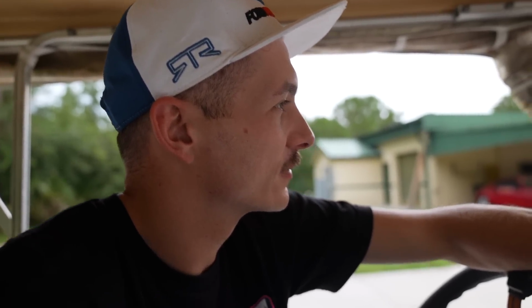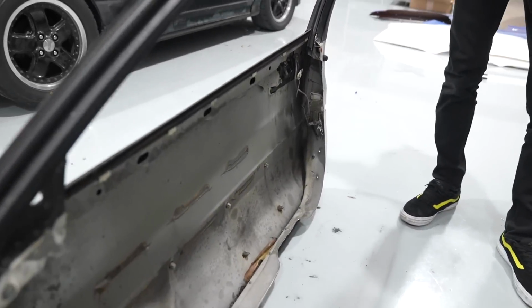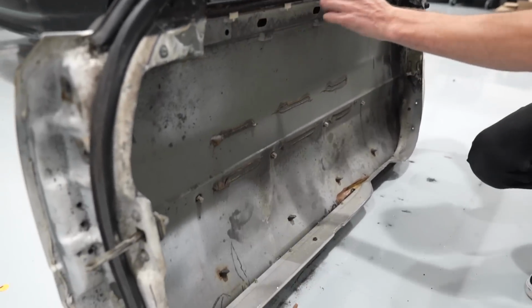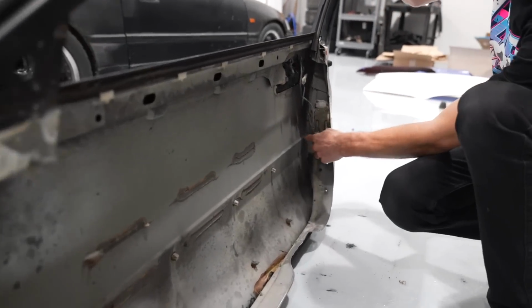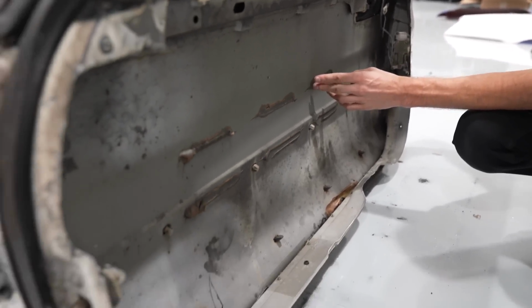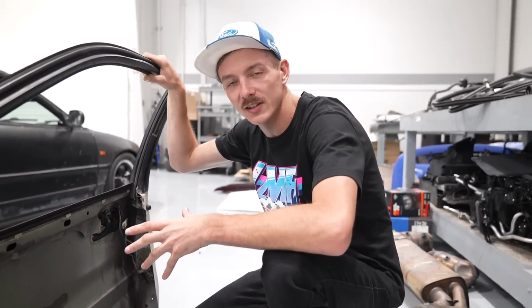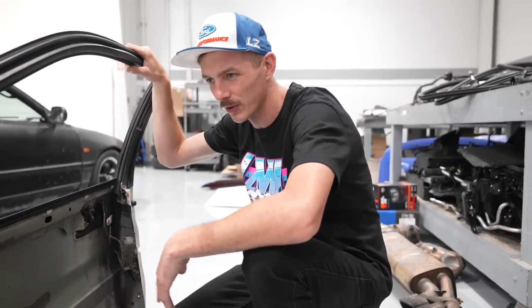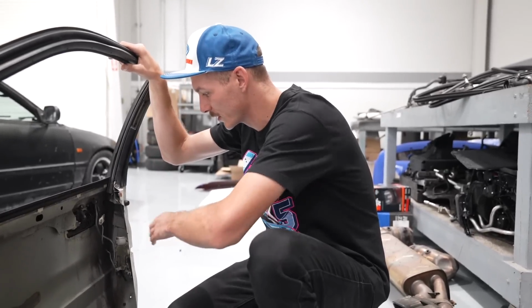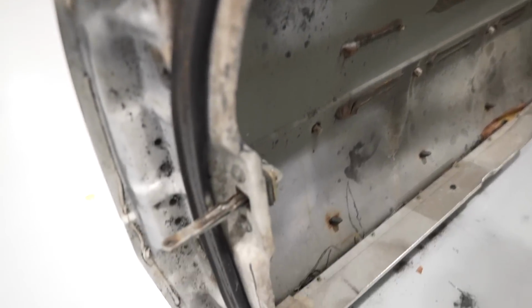Yeah, they're crazy. Here is the final rendition of the lightweight doors. Marco went and cleaned up even more stuff. I ran out of time yesterday. He was able to take this whole top piece off, and this bar actually had a couple spot welds that he was able to take out, so it looks way cleaner now. Probably grind this stuff down. I like to paint the inside of the doors too, so it looks nicer. Probably whatever color the inside of the interior is, I'll do this, and I'm not even worried about putting a door panel on it, because I think it'll look pretty nice. Make sure all these are not too sharp, so I don't cut myself.